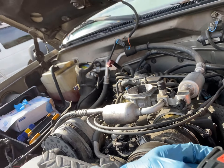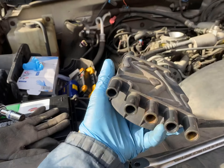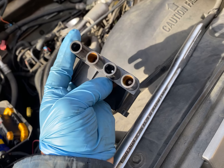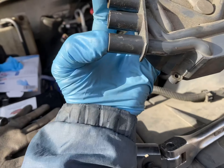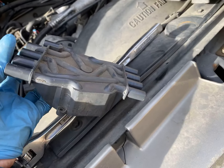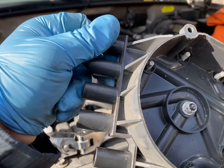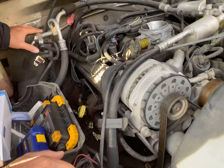But we can see some witness marks on the distributor cap. So the distributor cap sits like this. Here at the rear is the coil. You can see these two areas here — that's all rusted here, this one and this one. So there's issues with these two. And so inside here, it falls under that one, and so there could be issues in here. Or my spark plugs are bad.